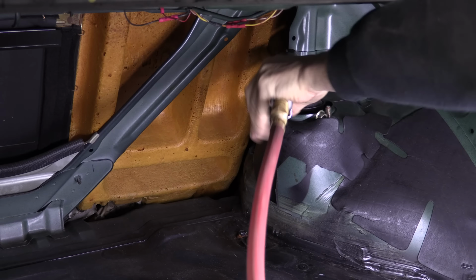All that old rotted rubber is still intact, but polyurethane is clearly a better choice for handling on a car like this moving forward. They're stiffer than rubber, and some people complain about ride comfort afterwards, but those same people also can't complain about steering response or handling. A stiffer suspension bushing makes the chassis react more quickly. But why are we still talking about bushings while I'm removing the brakes? I'm really just doing some weight reduction to the assembly before taking it all apart. Pull out the ABS bolts, etc.